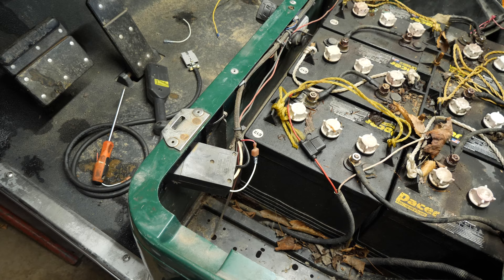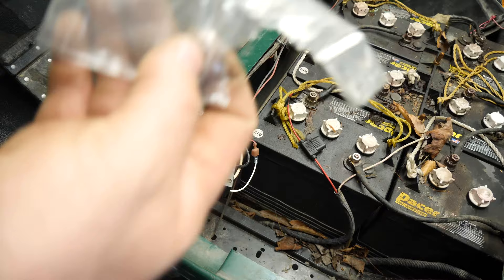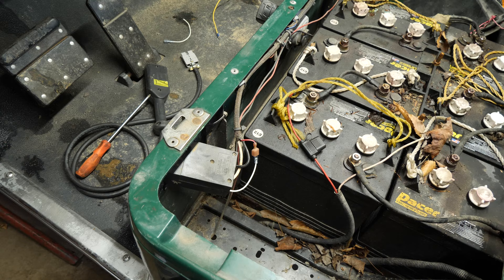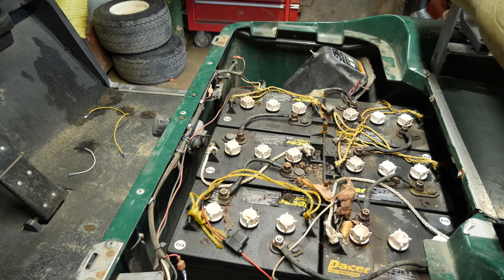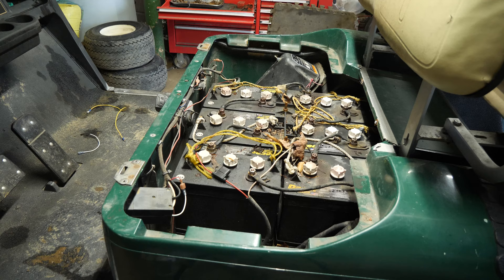Got to be careful with these — I just smashed that. Actually, that's the factory one. See, it's just a glass reed switch. A lot of times what happens is these things fail broken — the glass will break. So that's a fairly straightforward fix. It's safe, it'll work like it's intended — no bypassing of any wires, no jerry-rigging whatsoever. But again, you can use the jerry-rig method to get the cart back to wherever you need to bring it. I don't recommend leaving it that way though — just a disclaimer right there.